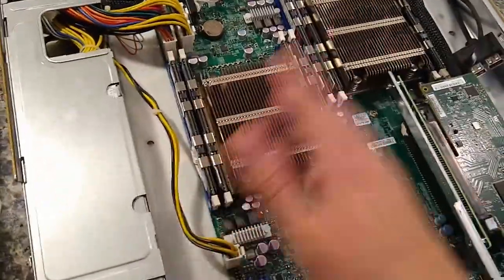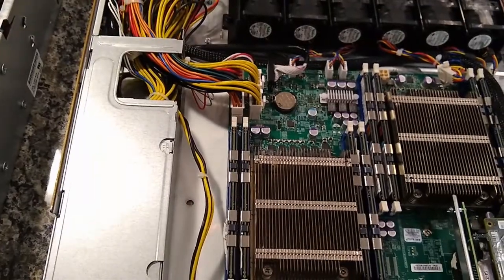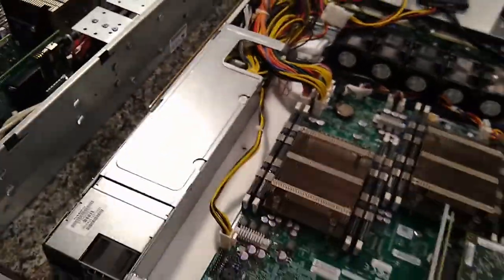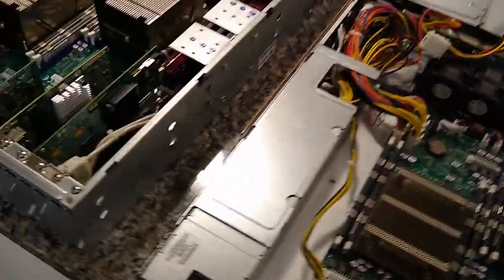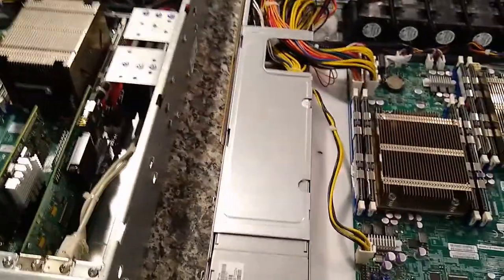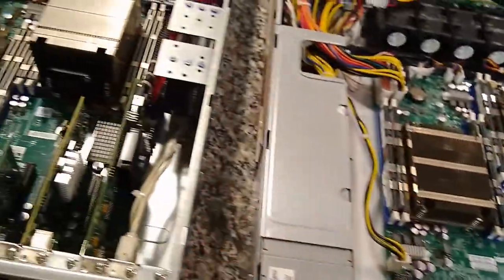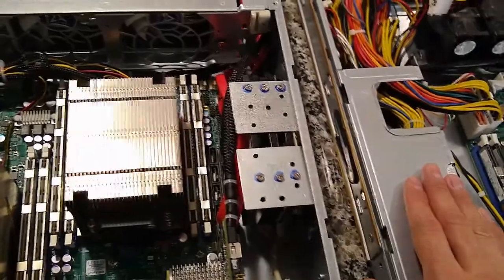Both servers have 64 GB of RAM — the RAM for this one was a matched set for $40 from the same seller. These are great systems — a lot of fun to build and do videos on, and they pair really well with ZFS and Proxmox for virtualization. I hope you guys enjoy these videos — let me know if you have any questions. I'm going to go over installing Proxmox and also the IPMI is awesome: you can turn these on remotely, mount a virtual drive, and install Proxmox by mounting a CD image remotely. You can boot from a virtual drive — this is stuff you won't find on mainstream consumer-grade hardware, so definitely check it out if you're interested.